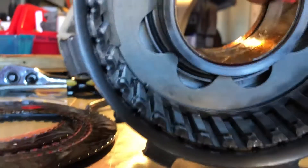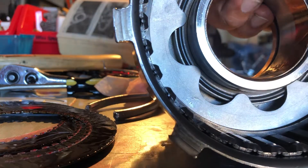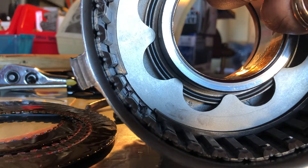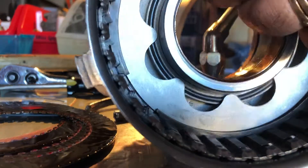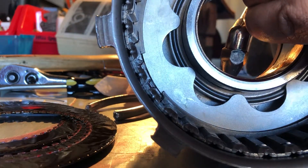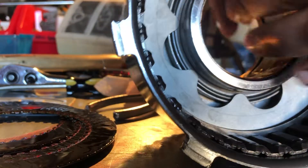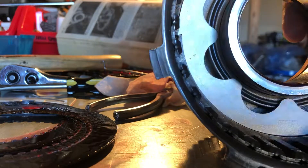What I'm going to do is cover the hole on top and introduce some air into the hole on the bottom. You should see that piston go up and down as I apply air pressure. The Belleville spring is quite strong, so it takes a little bit for it to move — just keep an eye on it. I do this on every part I build. I only have about 50 psi in my air hose right now, so it'll only move so much.